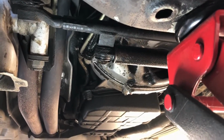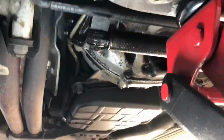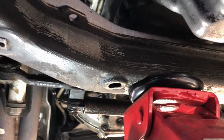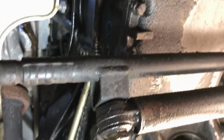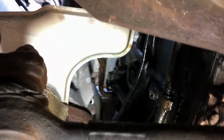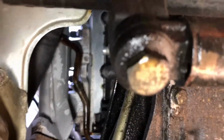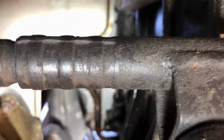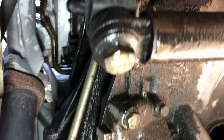The bell housing, there's drips there. I don't know where that's coming from. Looks like motor oil. I'm just taking it easy and going slow. Okay, gosh. Now, what I'm looking for, I know it's back here somewhere, is the drain for the block, somewhere up in here. I can't really see it. Oh my God. Freeze plug. Yeah, it's somewhere up there. Probably got to get it on the other side of the wheel to get to it. I've gotten to it before.